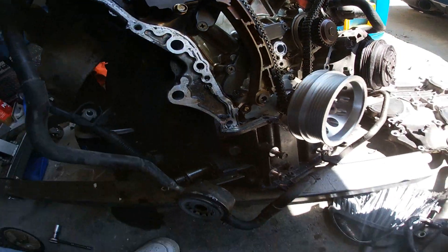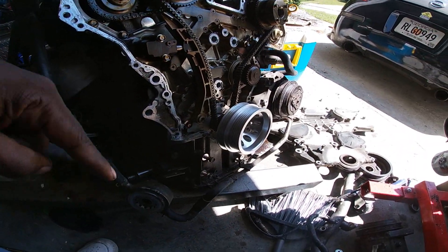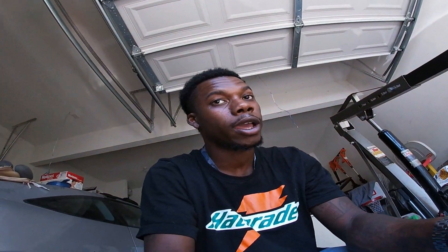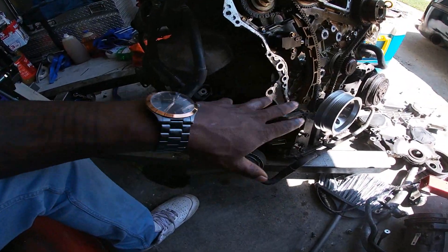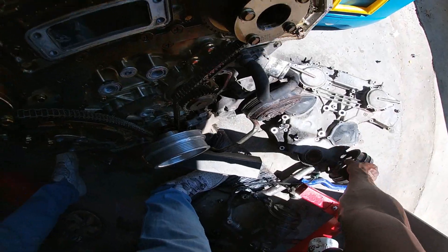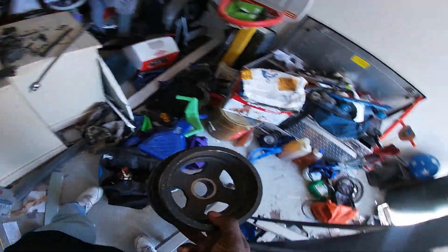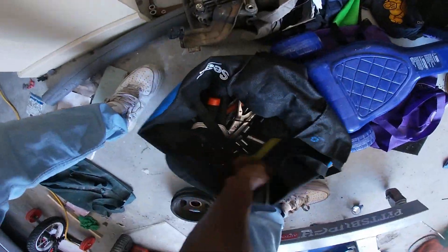It's still sitting on there and I'm going to be able to do the oil pump without removing the oil pan at all. All I'm gonna do is just drop it down from the bottom, because once the lower oil pan is removed all you gotta do is remove the lower oil pan — you do not have to remove the upper oil pan. You can get access to everything you need by just removing one oil pan. So first things first, you crack open this crankshaft pulley.